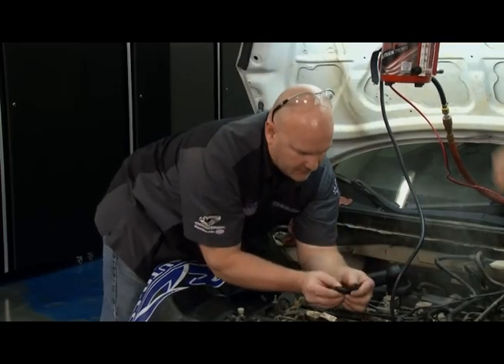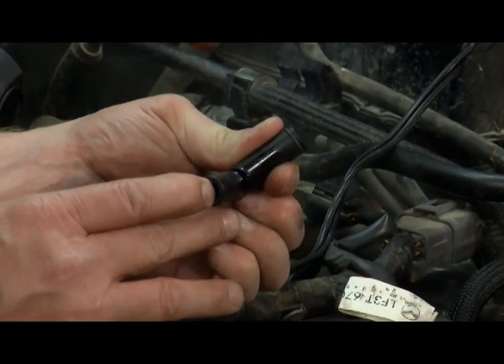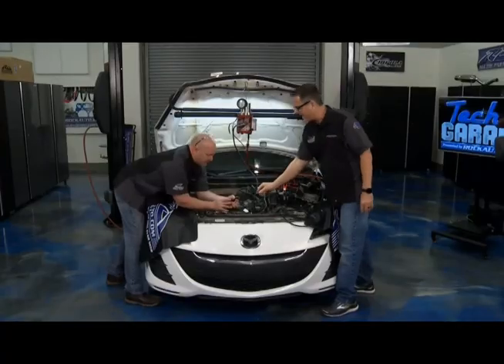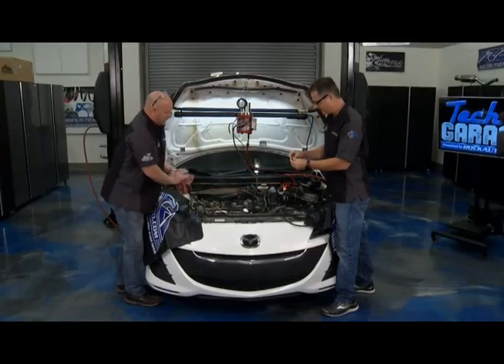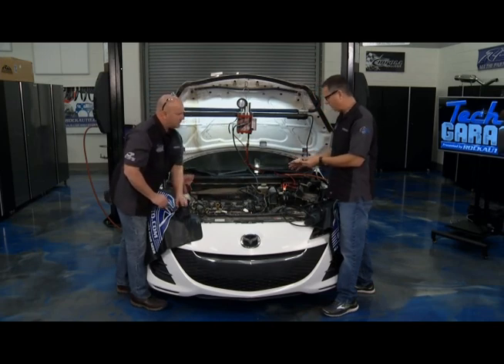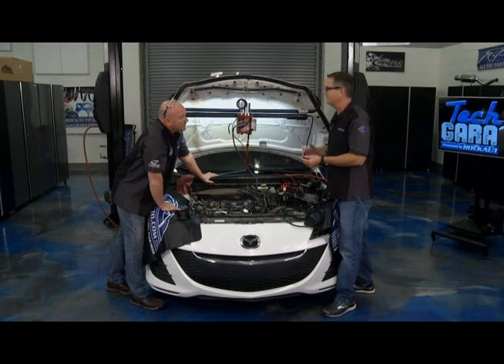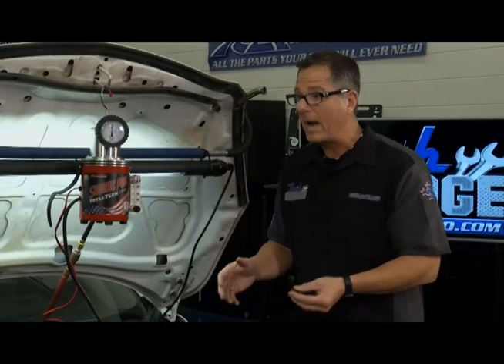There's the elbow, the culprit. You could call that a broken elbow on an EVAP line, or you could call it a lean code. I think that's our culprit. And you think about that for a minute — I can see it's cracked right there, probably in the seam. Totally normal. But on the EVAP system, kept driving along, that may even cause an EVAP code. The check engine light caught it with lean. But once again, that's way too much air.